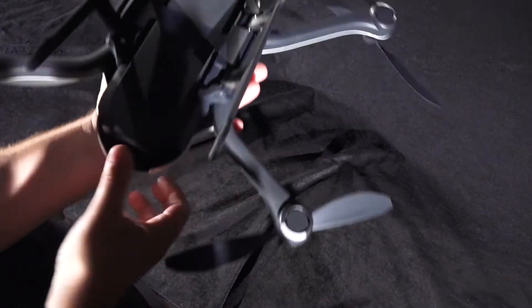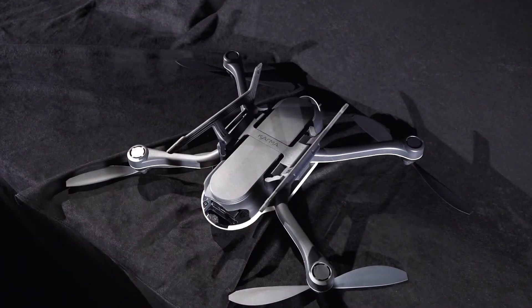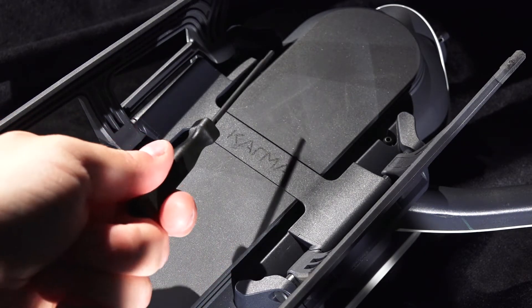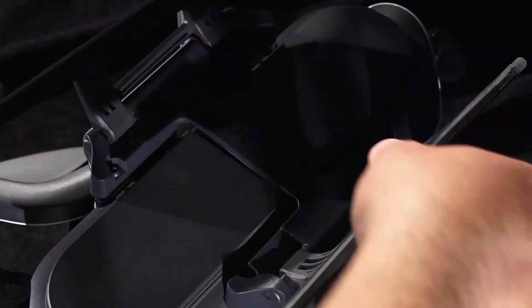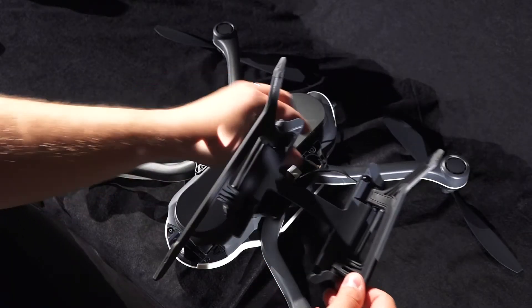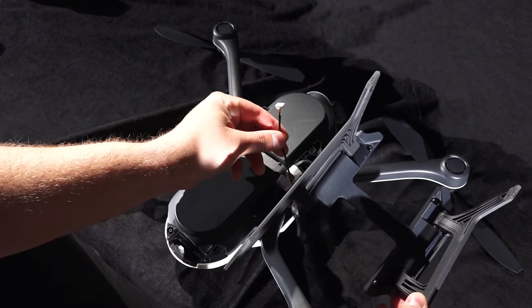Use a clean surface and turn the Karma upside down. We first need to remove the landing gear, and to do that we will loosen the four screws at the base. Once the screws are loose, the landing gear will pop out of the bottom — but be careful, it's connected by a cord. That cord needs to be removed from the landing gear before we can continue.